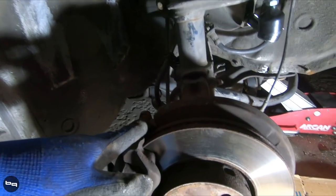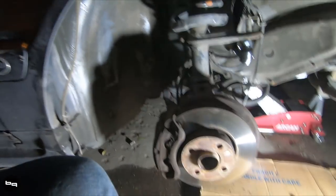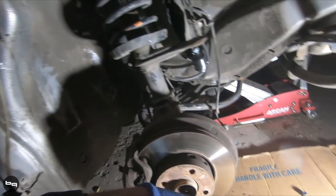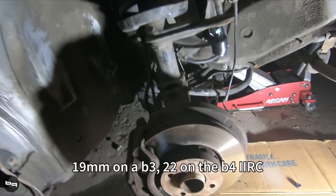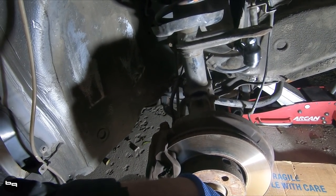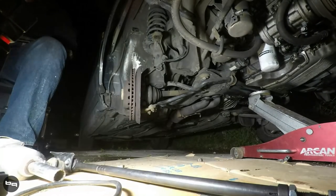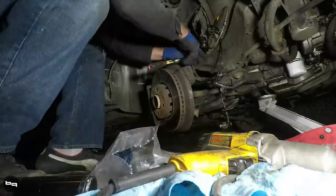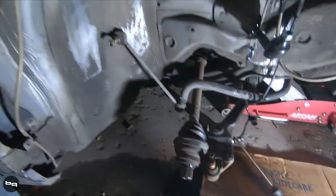Now you know what we're doing. Hopefully the time-lapse is pointed at the right place - let's try again. Now I'll start buzzing all that stuff off. These are just 10mm bolts that hold that on, I believe the others are 17mm. We already have the tie rod off because we just replaced them. These larger ones I think are 21 or 22mm. I can actually take them off together since I'm not using either of those parts, but I do need to disconnect the brake line. Alright, that step's done - looking pretty empty under here.